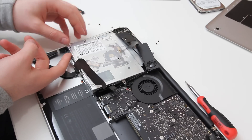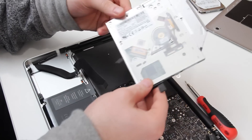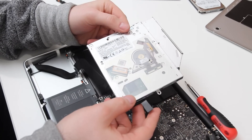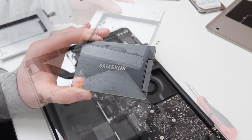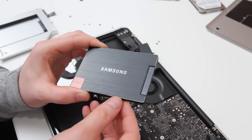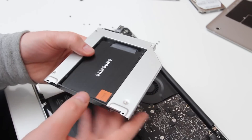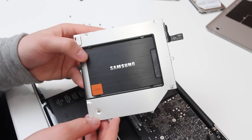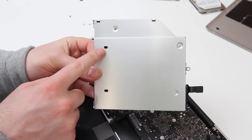If you're like me and you rarely use the optical drive on your system, removing it and using one of these adapters is a fantastic way of improving the functionality of your system. If you want to go with two SSDs, you could get a performance RAID, or use it for redundancy by having a backup drive right in the system. I'm really a big fan of this — it's the main reason I still like the older design of MacBook Pro. Yes, it's a little bit thicker, but having the ability to pick the latest and greatest SSDs and install them whenever you like, with just half an hour and a couple of screws, is invaluable — especially for a pro user constantly looking to upgrade performance and also looking for redundancy and backup.